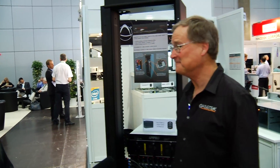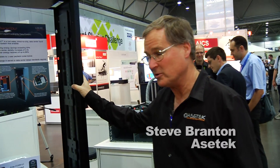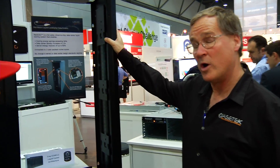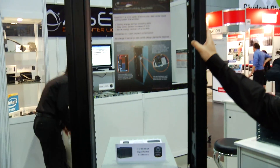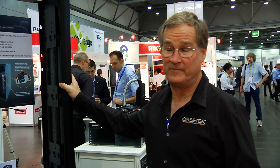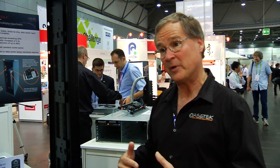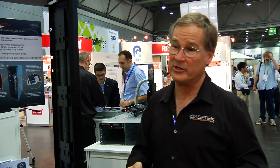Correct — hot water liquid cooling. This is a hot water liquid cooling system that does direct-to-chip liquid cooling. This is actually our first commercial development with Cray. This is the cooling system that goes in the CS300LC. It runs water in at 40 degrees C, which allows you to do chiller-less cooling. That's important because chillers use up most of the energy in a traditional cooling system in a data center. In addition, we're able to bring the water out at 58°C, which is warm enough to do domestic water heating, building heating, and even absorption-type chilling. So lower cost of cooling on the way in, and the ability to recover all the energy you're using to run your system through waste heat recovery.